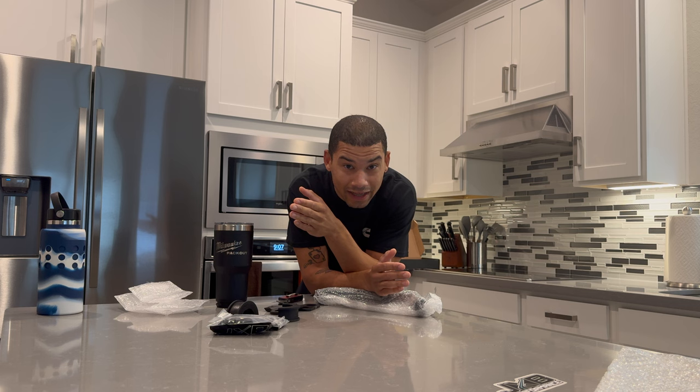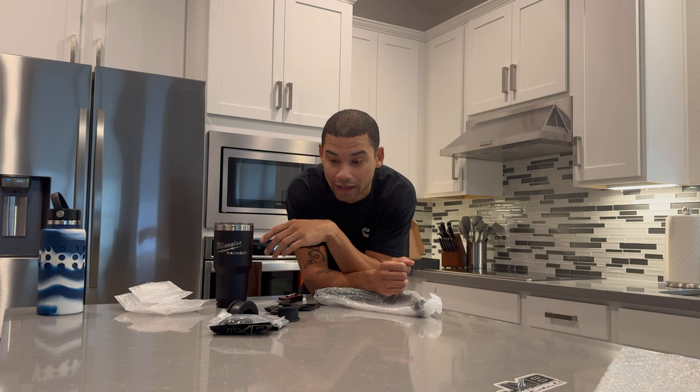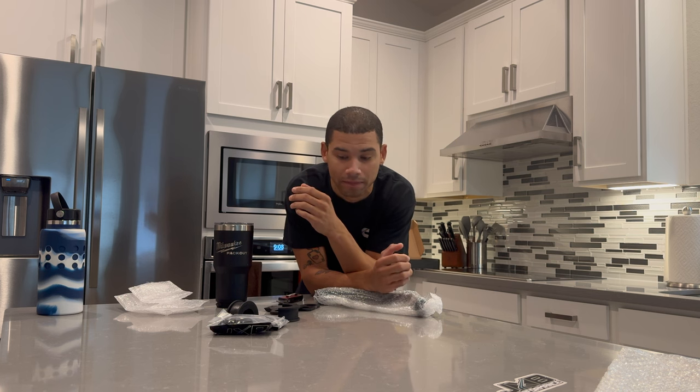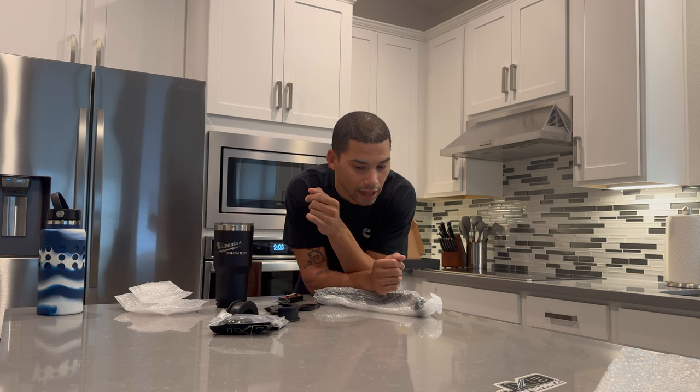But imagine if I can get like a 1.58, that would be insane with no Howdex tune, no Howdex spring. And we have 3.7 degrees of negative camber up front and negative 2.1 in the rear, and we're about to order coilovers. So if we can get into the 1.5s as we sit and then do the coilovers with the corner balance, and I did upgraded springs on them, and take some of that camber out, we're gonna go into like the 2.3 range probably up front. And fix the toe as well.